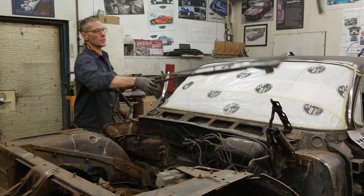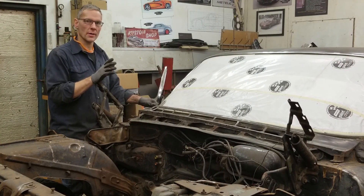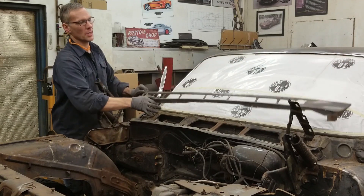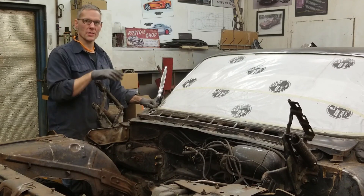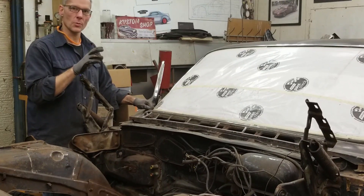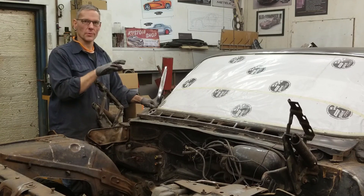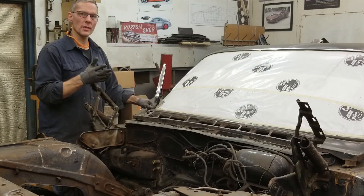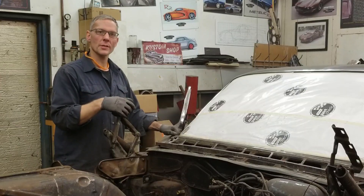I just got this cleaned up and it's looking good. We removed all the loose paint, all the peeling paint, and all the surface rust with the power grinder and wire wheel. You can see we've got bare metal showing on top as well as on the bottom — it's a really clean piece now. Next up is sanding, but we're not going to do that today; we're going to stockpile a bunch of stuff for sanding all at once. I just wanted to show you how to remove a stuck fastener and make easy work of that — it saves you drilling them out. Also, how to clean up a delicate part like this. If you don't have a wire wheel for your grinder or drill, just pull out a manual wire brush and do it by hand. It'll get the job done, just takes a little longer. Thanks for watching — see you next time.